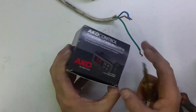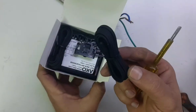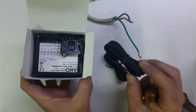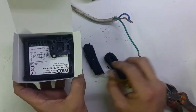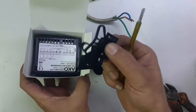With this controller there are two probes — this is a double probe controller. One is used for the evaporator, which works for defrost operation, and one probe is for cabinet temperature which is shown on the display. These two are locked.